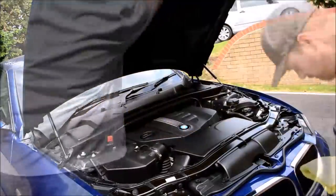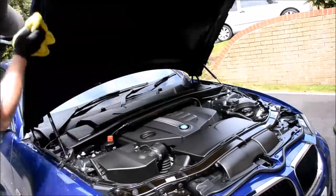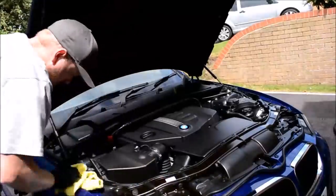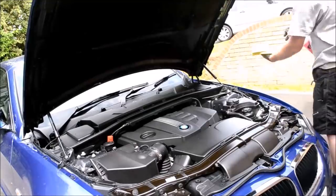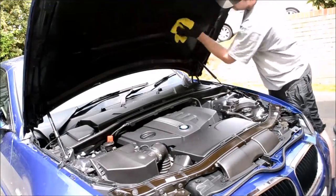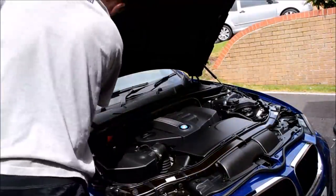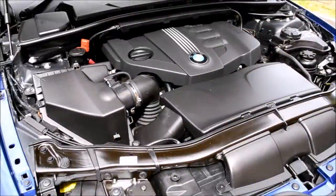The final step in my engine bay detailing process, using Meguiar's quick detailer and a microfiber cloth, I'll look over all areas and ensure a squeaky clean finish. Chances are you will find a few drips and runs from the insulation material. Also, there's a lot of hidden gaps and crevices inside the engine bay and underside of the bonnet, so it is inevitable there will be a few bits of water and product here and there. Using the microfiber and quick detailer, I'll remove all the offending drips and ensure a professional finish is achieved, before standing back and admiring my results. Engine bay complete, and what a difference it's made.